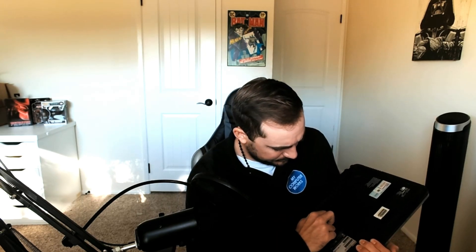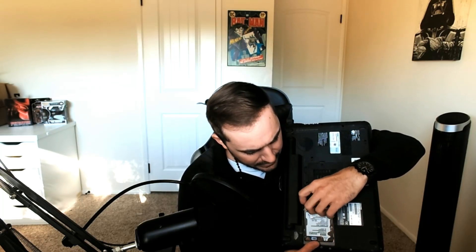We can just slide that right out — oh, this one is mounted. I can actually see a mount screw there, so I'm going to undo that first. That was probably the hardest screw out of all the ones I've done so far, but this thing was made 25 years ago. Once I got that screw, I was able to pop the drive out. This one is actually inside a tray — that's the technical term. I'll have to get the tray off before I stick it inside the enclosure. This is the hard drive enclosure — it slides open just like the SSD one.